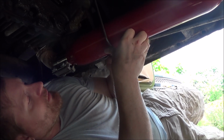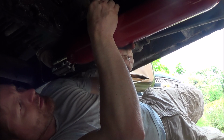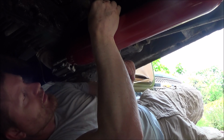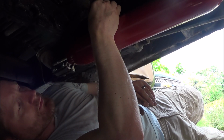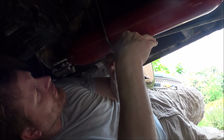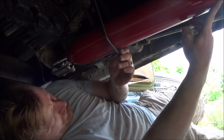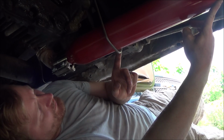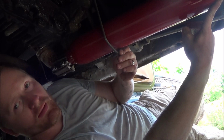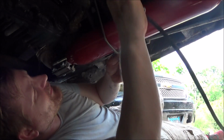So I'm going to weld this into place now, and then from there, just tack weld the rest of the stuff, the exhaust on here, to the hanger. And this should be good enough to hold it in one place, I think. Just one quarter inch rod. If not, I'll toss another one up here, but I think I should be good. If I tack it here and tack it there and up on there, I think that's sufficient. So let's try to get it all welded in place.